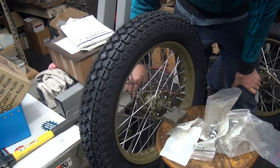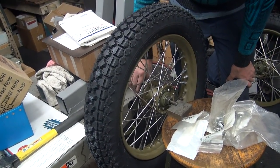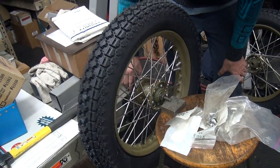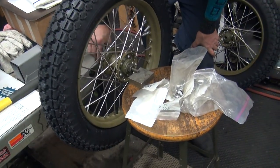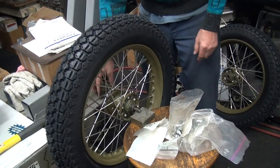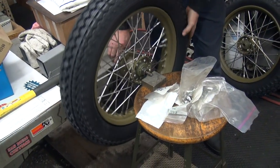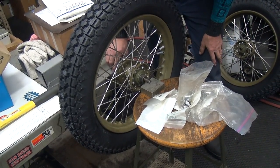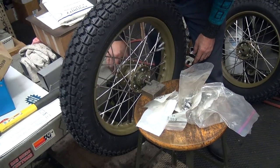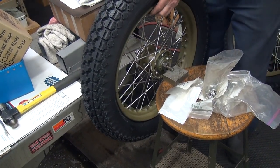Pretty close, but hopefully the tire is going to wear more. Right. This high spot should go down a little bit. It won't be so heavy there. You never want to be heavier than you need. Right. Being a little light is not going to hurt us. It's less than a quarter of an ounce. It's okay. Eventually, it's going to work. It's all the way around where it was heavy in the bottom again. So you want to see where your maximum air is. You go 90 degrees to wherever your weights are at. This is where your maximum air will be. Right. So this is where you check to see where your air is at. See, it's not that much. It just starts moving the bearings back and forth, but it's pretty close. We still got a lot of heavy seals and stuff in here. Right, right.